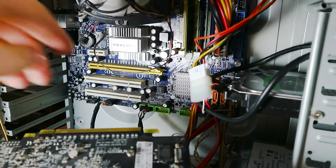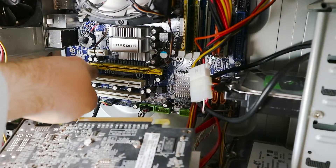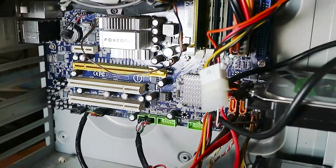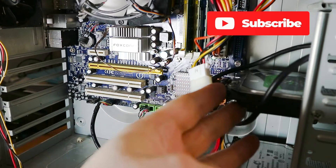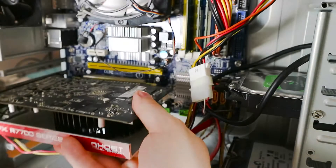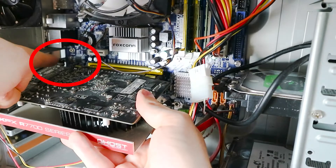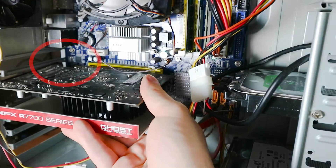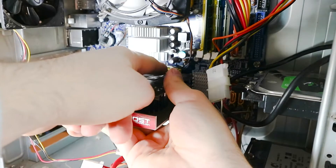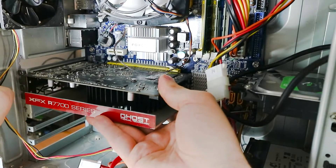This is where the AMD or ATI card will go in — not old enough for AGP, don't worry about that. We're gonna have to connect these pins to this panel. It's usually easy to spot by having a little lever to stabilize graphics cards. If it's a cheap case or doesn't have enough space, it's ideal if you have the hard drives installed already, because sometimes the graphics card will block taking these out or putting them in. Make sure you don't trap any cables. Pay attention to the back so you don't scratch the main board. You can just push it in.